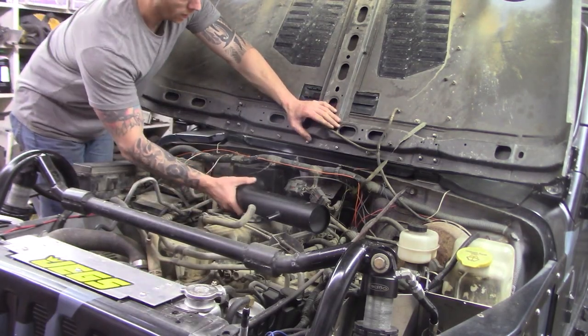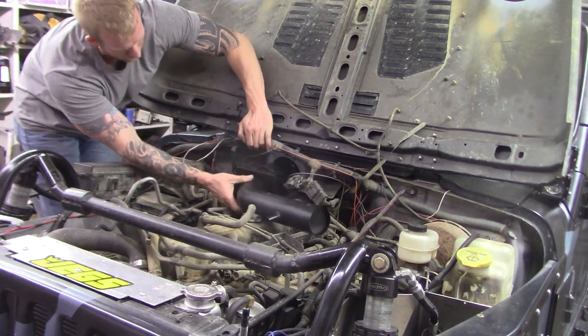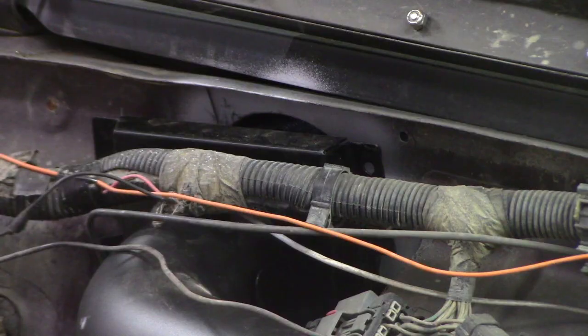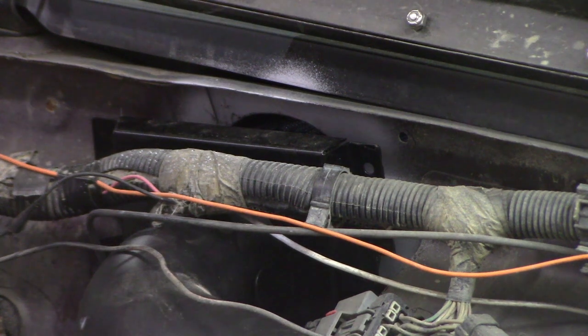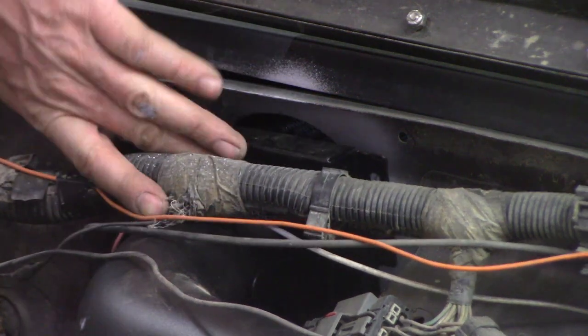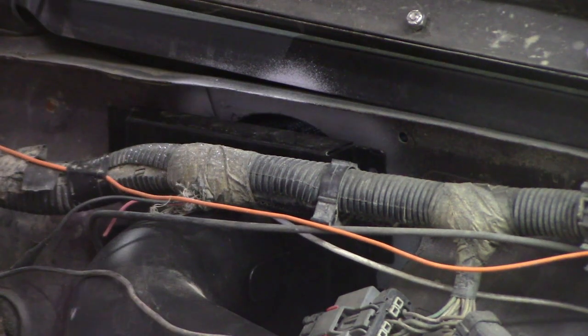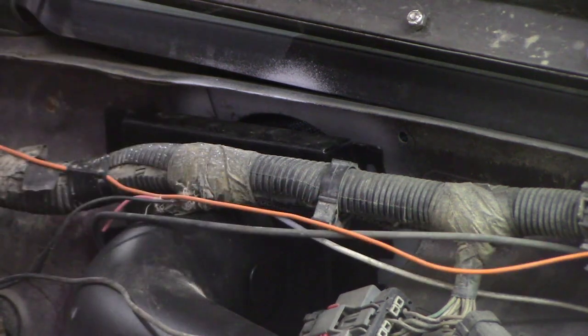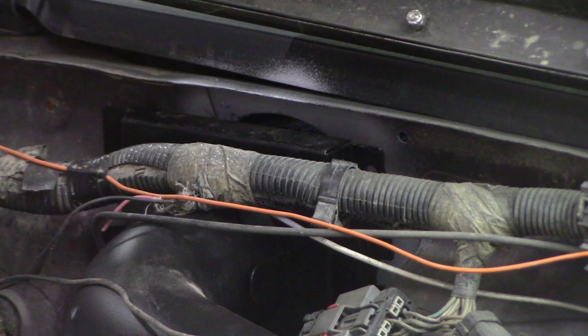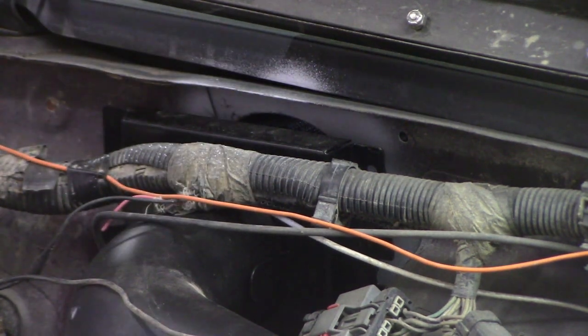The primer's dry and we got this assembled, so we're going to go ahead and stick this in here and get all these wires out of the way. Once you get it in there, it fits good. The next thing is it comes with four self-tapping screws — there are four holes on this heat shield, and we're going to self-tap it into the firewall. The only one that's going to be a little tricky is that one right there. I'll self-tap this one, this one, this one, and then maybe turn this since it's going to be in the way, and do the last one.